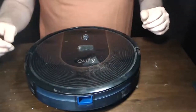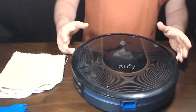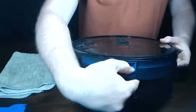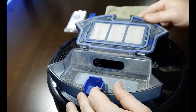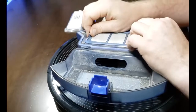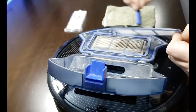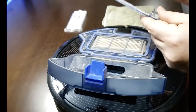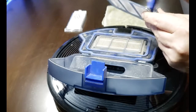That's how you clean the RoboVac 30C dustbin. Now here's how you clean the filter and the pre-filter device in the dust collector. Find that blue button that releases the dust collector from the Eufy RoboVac, pull it out, and you may have to press the blue button again to release the top of the dustbin. Then pull out the pre-filter device and clean it out with the brush provided by Eufy. It's also optional to rinse it with cold water, but Eufy strongly recommends — and I also strongly recommend — that you let it dry completely if you choose the water method.